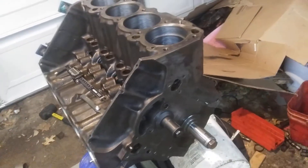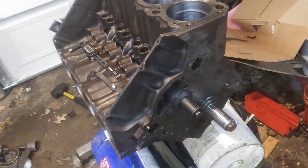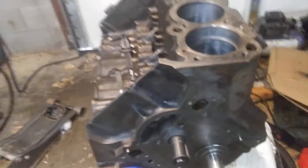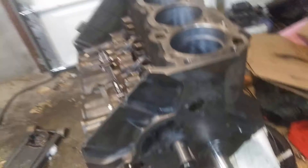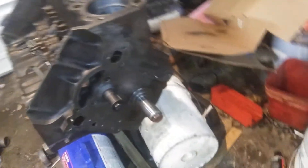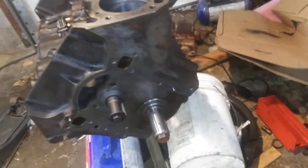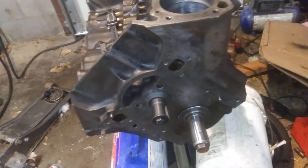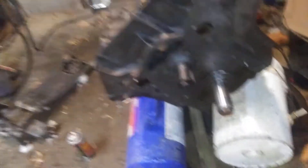If you use a 20-thousandths steel shim head gasket from TA Performance or another vendor, you could get that extra half point in compression and bring it up to about 10.2 to 1. I don't want to do that because Buick 350s running iron heads at 10 to 1 compression on 91 octane is just a no-no — it'll detonate like crazy. So until I get aluminum heads, which are most likely going to go on that motor, 9.5 is perfectly fine. You're not going to notice or feel the extra 15 horsepower, maybe, from the extra half point of compression.